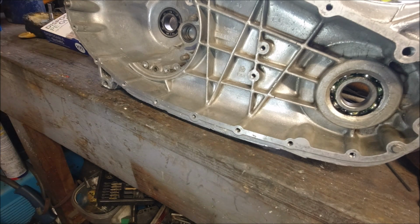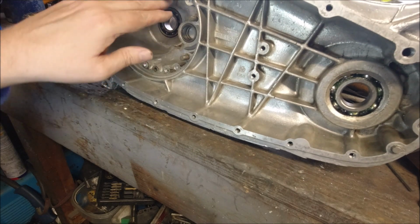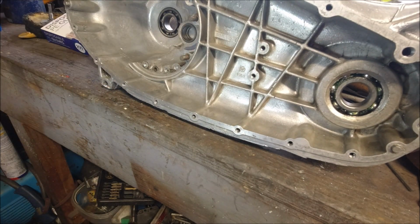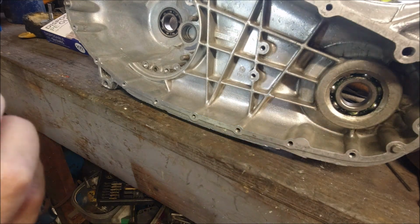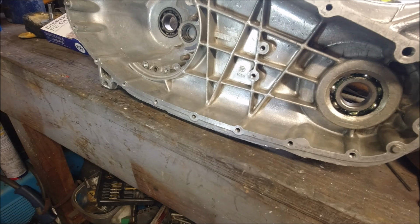If any of you are starting out building, like I say, there's loads and loads of videos on engine casings, but I'll take you through checking all of these, fitting the rear end plate, Christmas tree. You leave that out when you're shimming a gearbox till you've shimmed it up correctly. I'll show you how to go through the different shims, what feeler gauges go where. A lot of that's a bit of a mystery from what I can see.